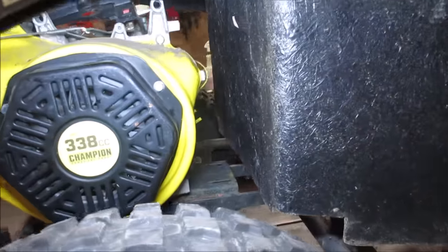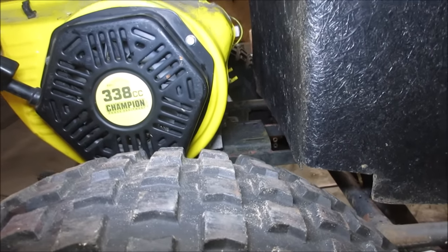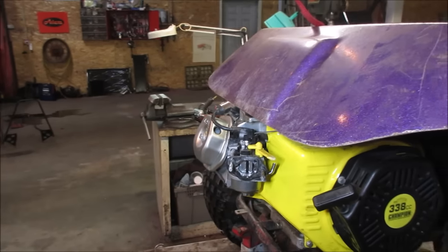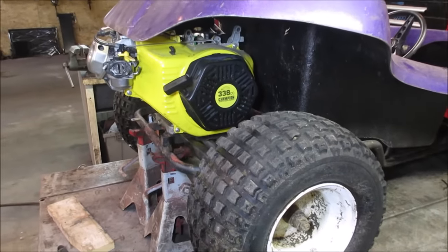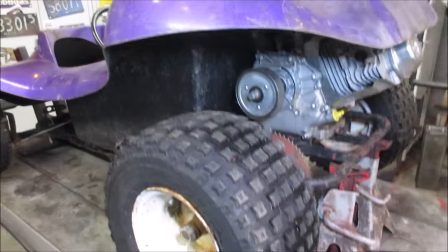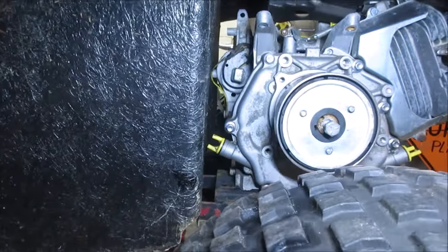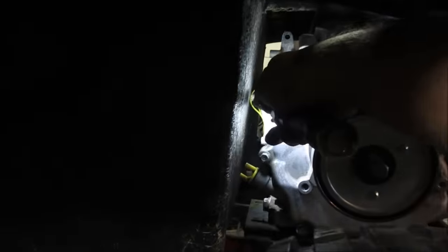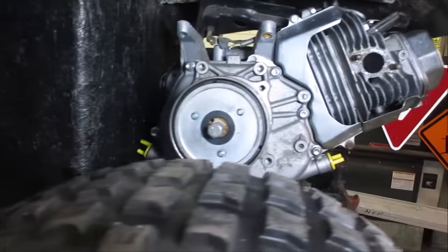And we could slide the engine forward about 2 or 3 inches. Let's do that. I don't think we're going to clear that plug setup. We still have to cut around that piece right there. Let's go kick it forward just a little bit. I think that's all it's got. We can grind whatever that tab is right there. That's where the fuel tank, I think, sat. That tab right there. If I grab another half inch off of that.